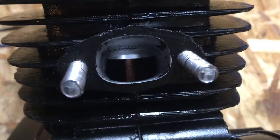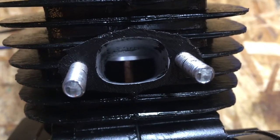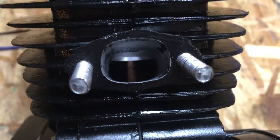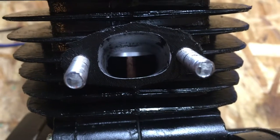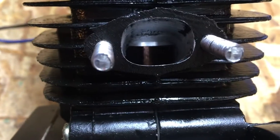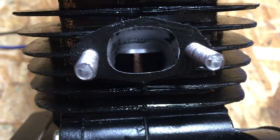As you can see, there's still a sliver of the piston skirt visible inside of the intake port, even though the engine is at top dead center. That decreases the airflow slightly, which also decreases the horsepower capability. So what we're going to do is trim the bottom of that piston skirt so it perfectly matches the port.